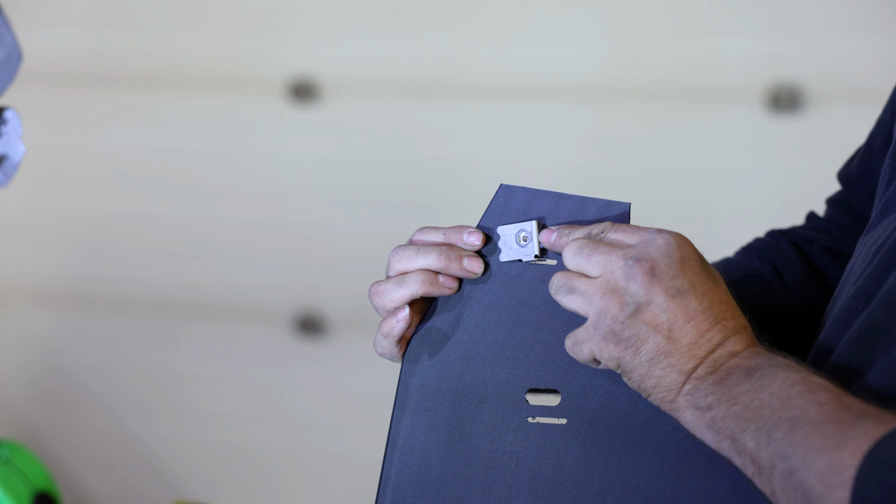Finally, secure the hole seen here using a machine screw and a flat washer. Place this hardware through two spacers on the back of the flap when securing this part of the assembly. These spacers are positioned here so the mud flap doesn't bend inwards at an awkward angle. Then, remove the clip and discard the plastic insert located inside the groove on the bottom of the nylon. Once done, insert the rubber and glue of your kit into the nylon and secure it in place by reinstalling the clip. Make sure you push down until you hear a distinctive clicking sound to fully secure the clip.